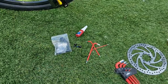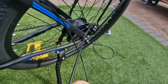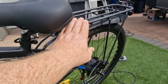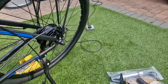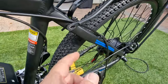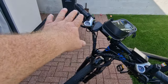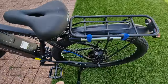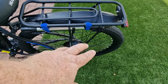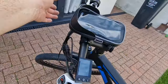We've used just three allen keys so far. If you've already built your bike and you're running the new brake caliper down to the rear hub with the bike rack fitted, the easiest way to get your cables out is to just pop that bolt out — that's the only reason I'm showing you this, because I got stuck trying to get the old lever through. New disc brakes on the front — new levers, hoses, and caliper. I've also changed the rotor on the rear wheel. This was all one unit: caliper, hose, and lever — that's the front, that's the back.